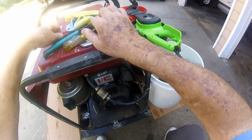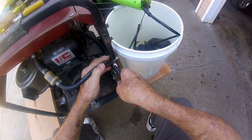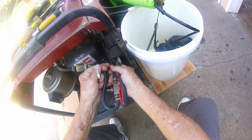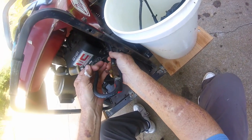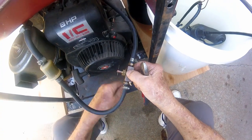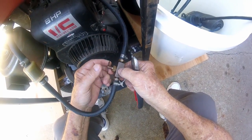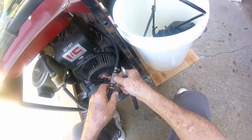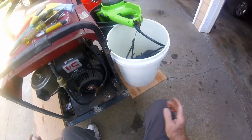Alright, that's snug. Die cutters here — I had this fuel line a little too long anyway. Let's take this zip tie off and see how much extra fuel line I had. I could take quite a bit of that hose out and still have downhill flow on the fuel line. I had way too much fuel line in there. This metal valve I bought at an auto parts place a couple years ago — didn't know about the little plastic ones at the time — but it takes too long to turn it closed and it's acting a little stiff. Let's put that new fuel line on.